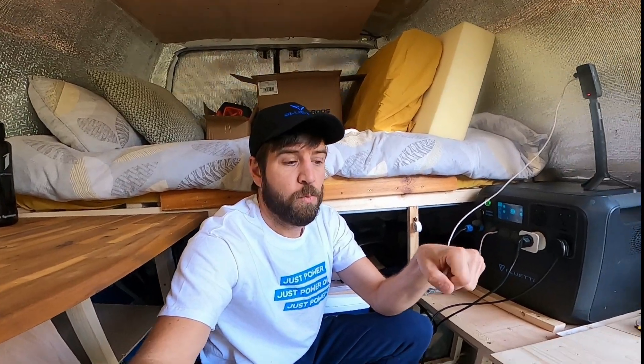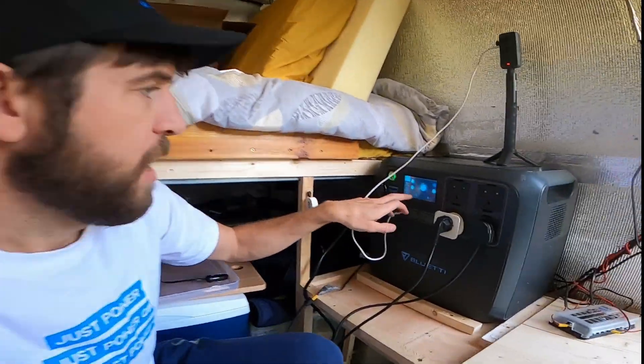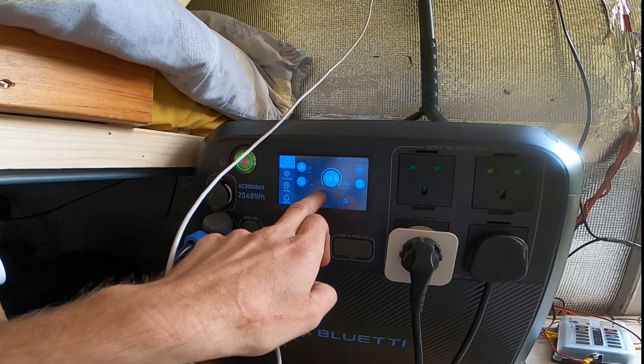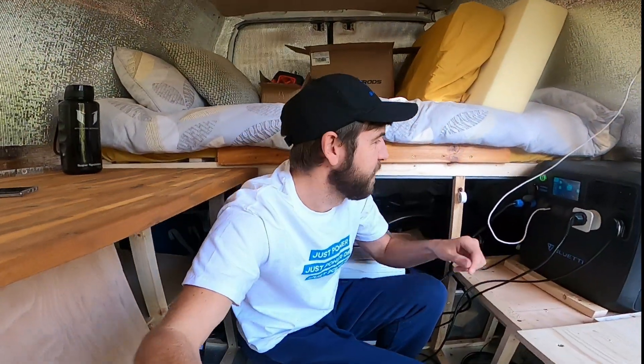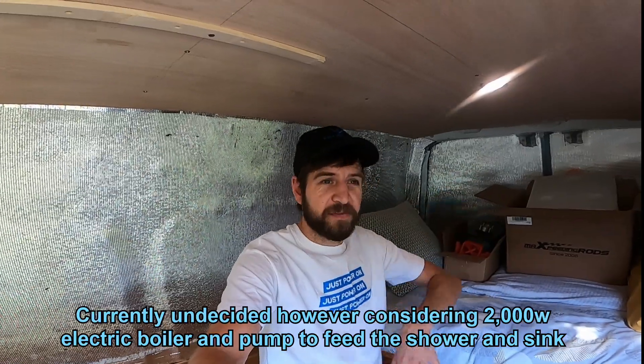If I plugged a hair dryer in while this heater was running it would probably trip. What it does is give you an overpower warning, cut everything out, and then you just press OK and it resets — it doesn't blow any fuses, it just trips out. As you can see the power is going down quite quickly, so you don't really want an electric heater in your van. I only had it because I was waiting for my diesel heater to arrive. You've also got things like microwaves — I've got a 900 watt microwave I could use in here. I'm also going to go for an electric shower rather than gas, using it for maybe three to four minutes so just a little bit of water and power.